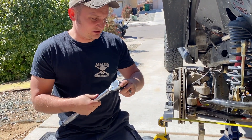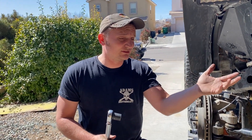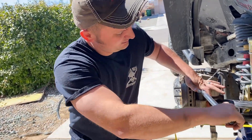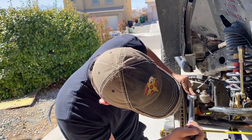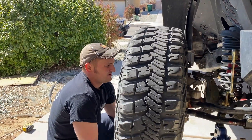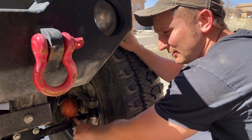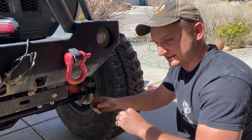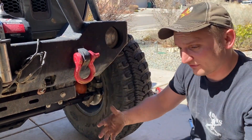So now we're ready to torque. Proper torquing for steering is super important — improper torquing, whether it be too little or too much, can lead to your steering breaking. SteerSmart's ends torque at 105 pounds. Torque specs: 105 on the tie rod end, 85 on the clamp. Just make sure when you're adjusting things, you're not rotating the tie rod before you tighten the clamps. Having the tires down on the ground will help prevent that.